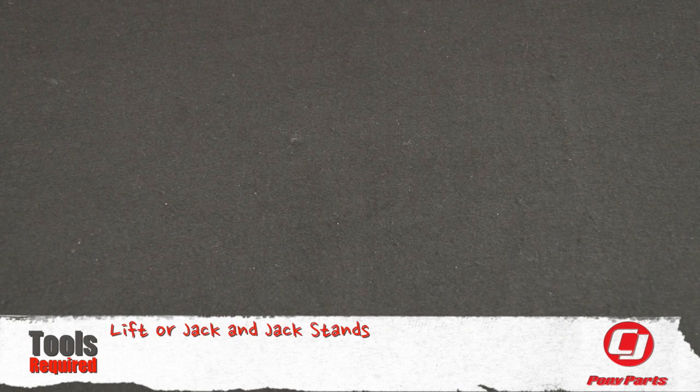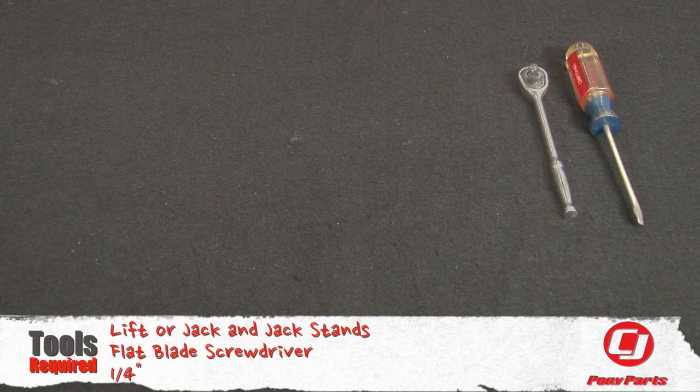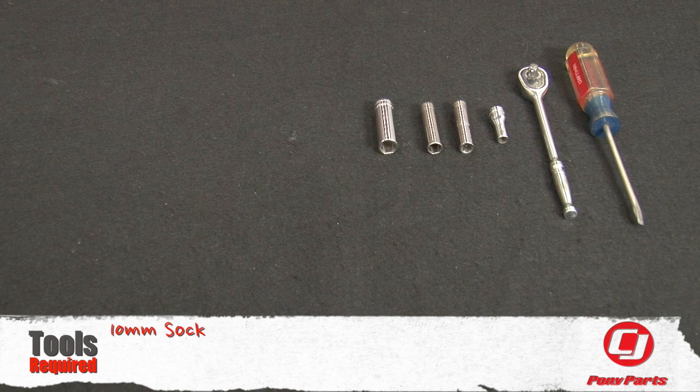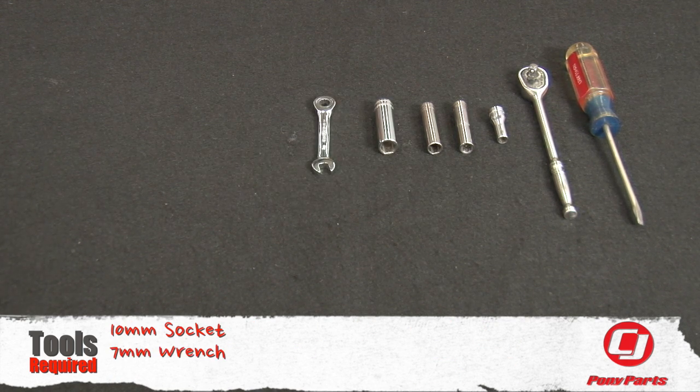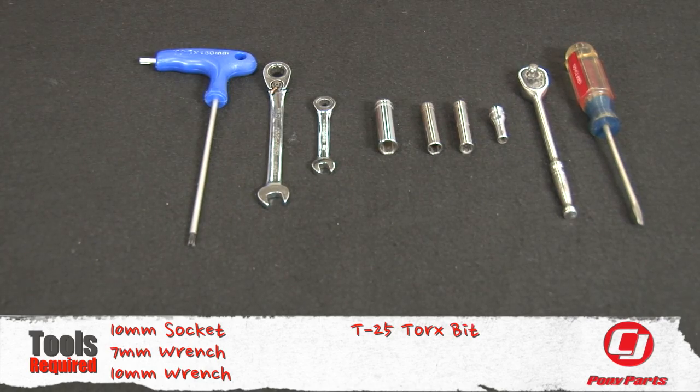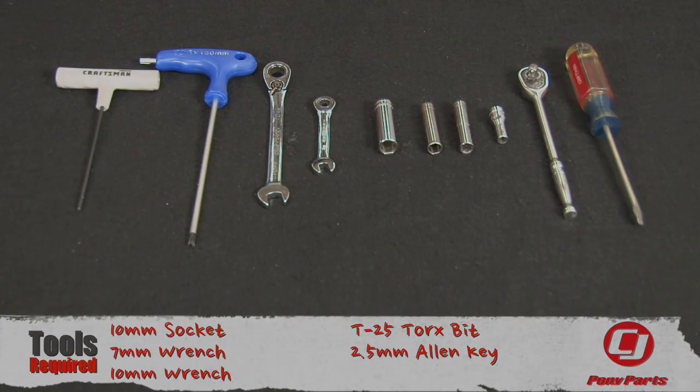For this installation, you'll need a lift or a jack and jack stands, small flat blade screwdriver, 1/4-inch ratchet, 7/32 socket, 7mm socket, 8mm socket, 10mm socket, 7mm wrench, 10mm wrench, T25 Torx bit, and a 2.5mm Allen key.